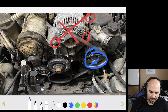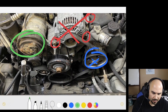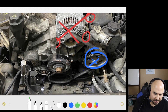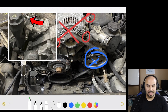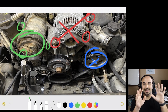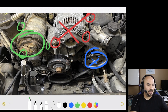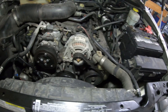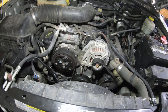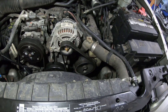The last thing you're going to worry about is your AC compressor. This is held on with three bolts. You're going to disconnect the harness connections but leave the Freon lines connected. Once you unbolt the entire assembly, pull it to the side, find something on the left side of the engine to pass some zip ties through, and zip tie it out of the way. That's going to save you a ton of time when you go to put your engine back in. At this point, you have taken off your AC compressor, your alternator, and your power steering pump — you should have nothing on the front of the engine.